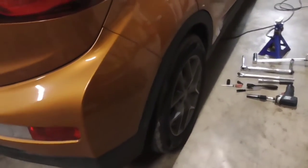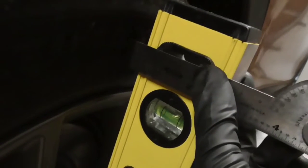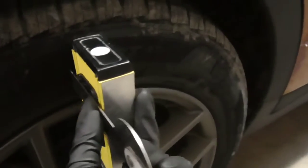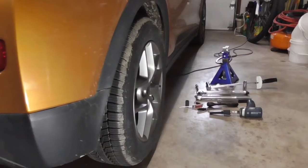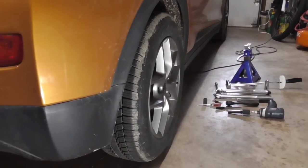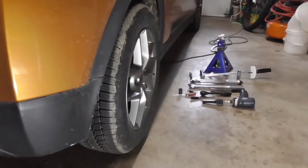The car's back down on the ground. I pushed on the shock absorbers a little bit on the rear suspension to make sure it's settled. Everything looks pretty good — I can clearly see there's a noticeable difference. Let's take the actual measurement: it looks like we're at about 12 to 13 millimeters, which is better than expected — that's right where we want to be and equal with the other side. Now that rear camber is correct, the next thing we want to do is check the toe and make sure that's correct. Usually rear suspensions are pretty good at keeping their toe — it's the camber that typically goes out.